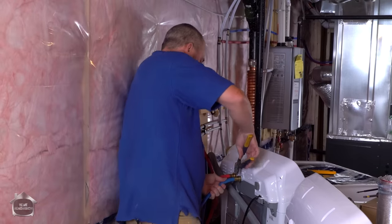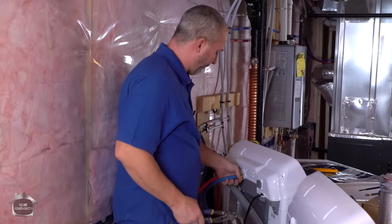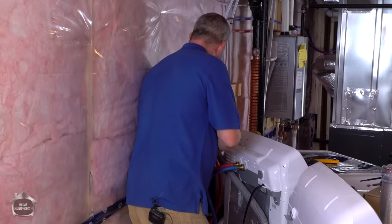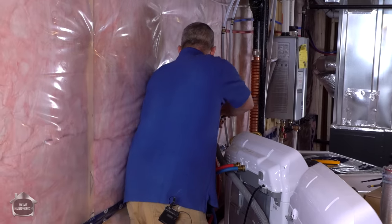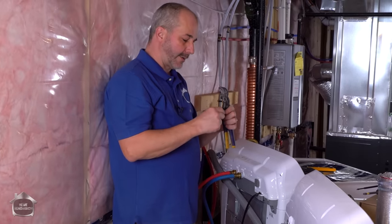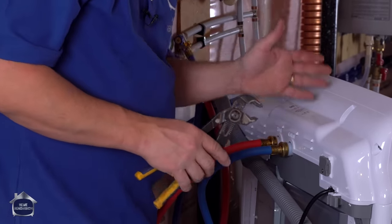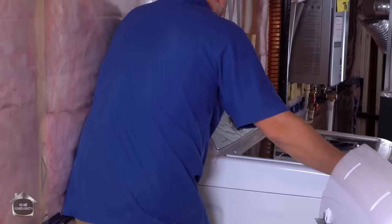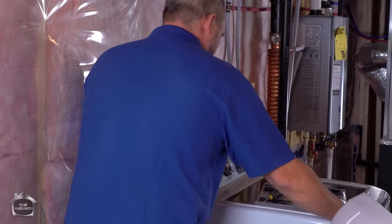You can see we've got a bit of a drip here — we'll add another half turn. If you develop a little bit of a drip, that means the washer doesn't have enough compression and the water is probably going to seep out right at this joint. Just give it a little bit of a tighten — not going to be an issue. There we go, that's perfect. So we have our discharge hose, our hot and our cold, and our power supply. That unit is ready to be used.